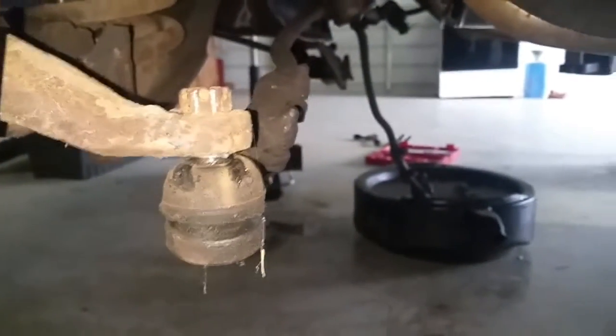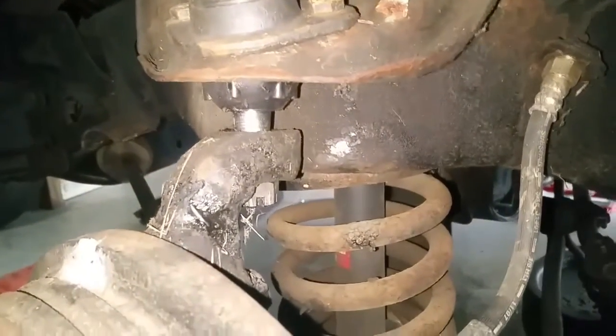This tie rod bolt is a 3/4 inch. So I'm going to get a break here — it's not too bad. You'll be using a pickle fork; I have two different sizes. So while I was banging this, the tie rod came loose and fell down, and at the same time the top fell down, which is good. But that's why it's important to keep the bolts on — you don't want it to fall and spring down and be really surprising.